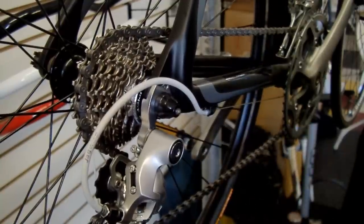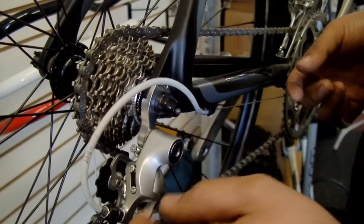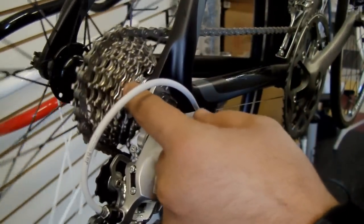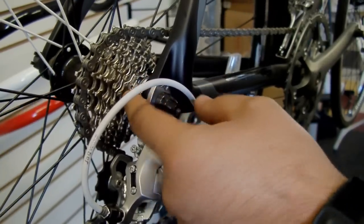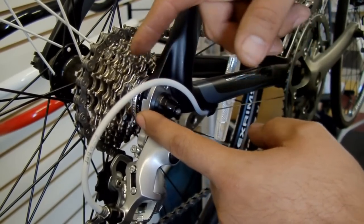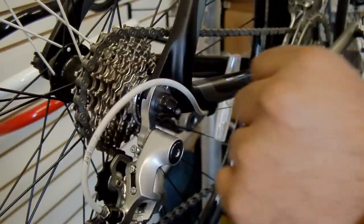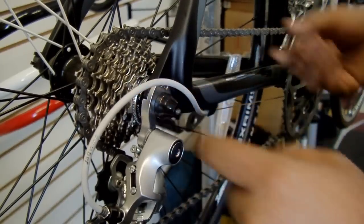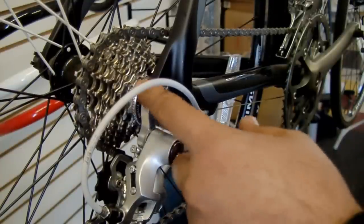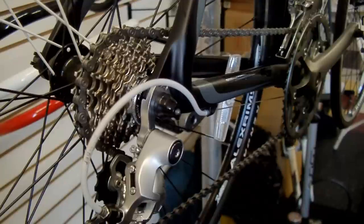In more detail, the first problem you may be having is with your drivetrain — this whole system of your chain, cassette, and derailleur. When those are worn, the teeth don't grip the cassette well enough to give torque to the wheel. When these teeth are worn or missing, the chain will skip out of place or into the next gear. That occurs from not maintaining your chain and not changing it every recommended 500 miles. If you don't oil your chain enough, these teeth and your chain will also spread open and wear down so that this system won't work properly. Always keep your chain oiled and change it every recommended 500 miles or so.